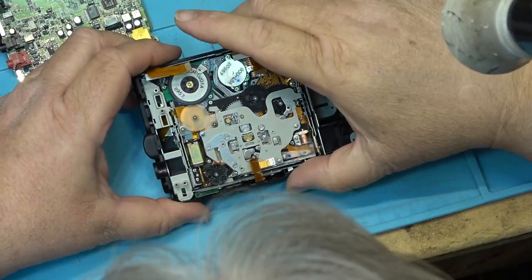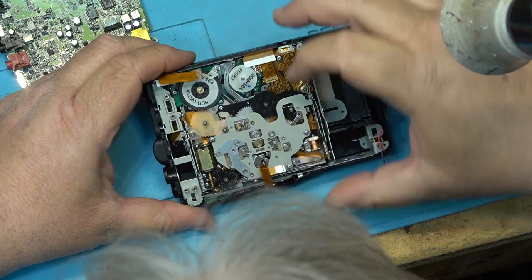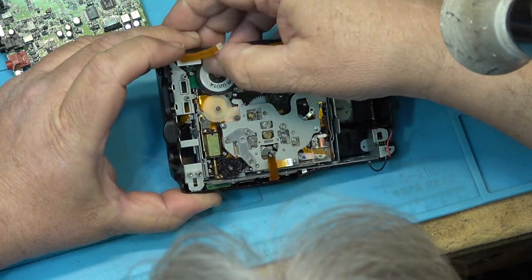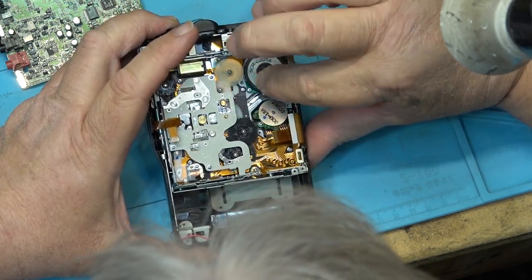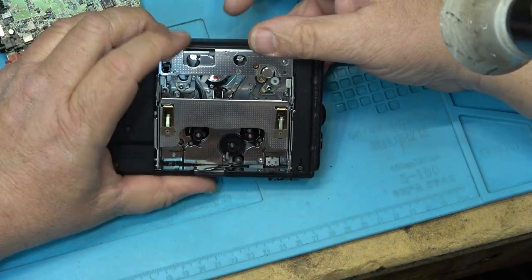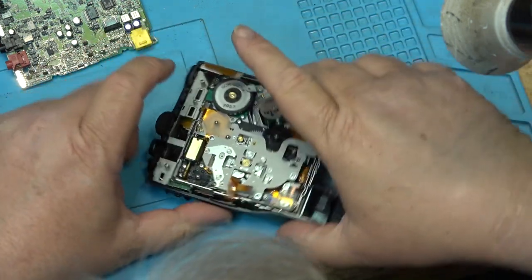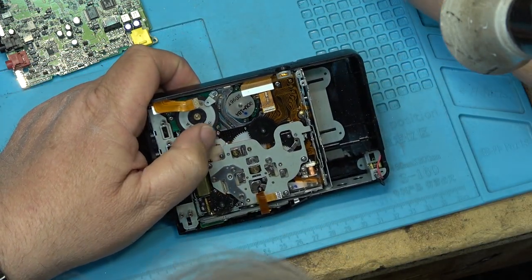As many of you know, this mechanism is loaded and unloaded by the capstan motor. It controls the mechanism through this little cam gear over here. If we trip the cam gear, this will spin and it should load and unload the mechanism — which it is. If I'm turning it here, it's loading the mechanism now. It makes one revolution and then stops. So the mechanism is now loaded. You can see that the guides are already up in their full loaded position.